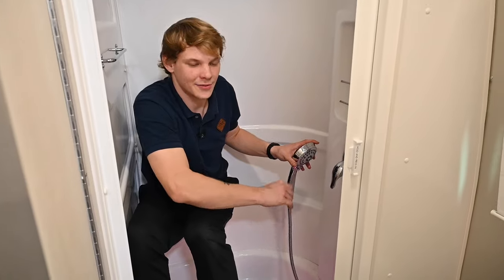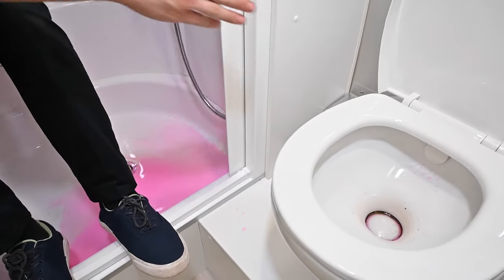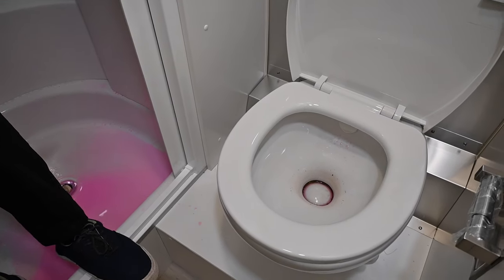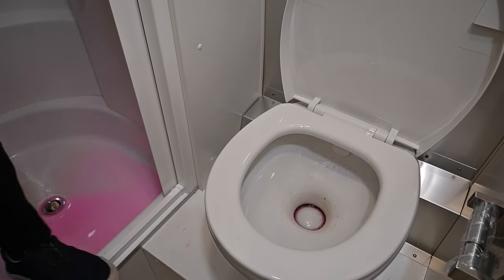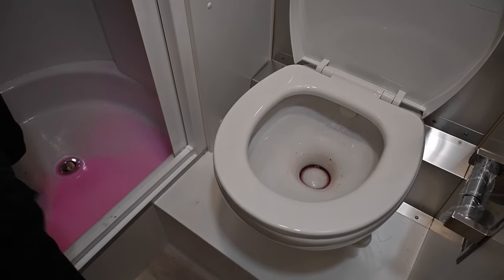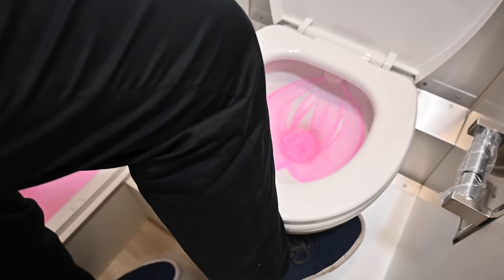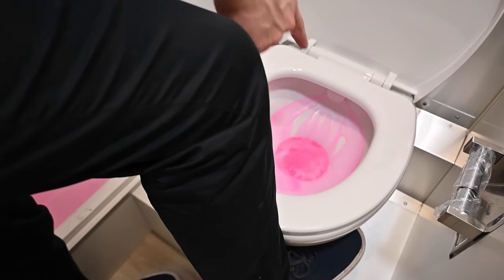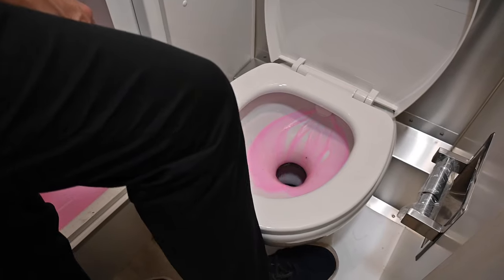Before leaving the bath cabinet, I still have the commode right here. I want to do a nice step-flush and hold for a minute, because that will run antifreeze through the back sprayer of the commode. I'll step on the step valve, hold to fill and confirm antifreeze is coming from the sprayer, then go ahead and flush to the black tank.